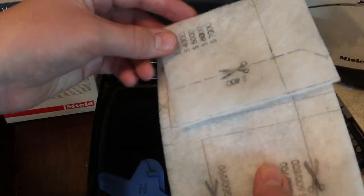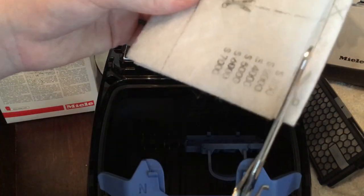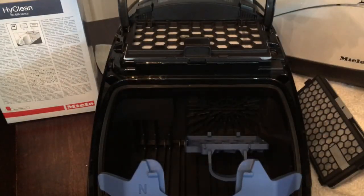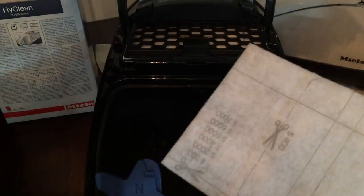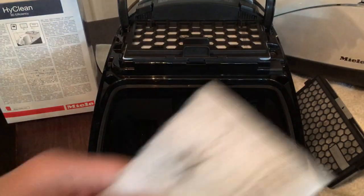To fit the pre-motor filter, the easiest way is to take your old one, place it on your new filter sheet, and cut around it. If your Miele is a few years old, look at the model numbers listed on the filter sheet. Although the newer Miele names like the Complete C3 haven't been added to the filter sheet yet, it still has the old names - just place your old filter along the cut lines to see where it matches.